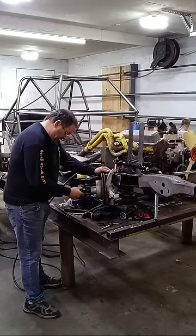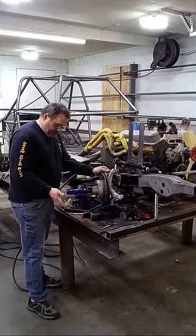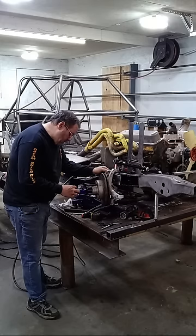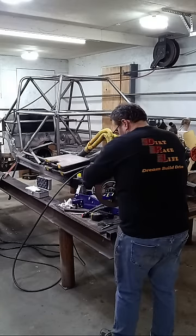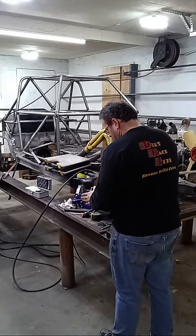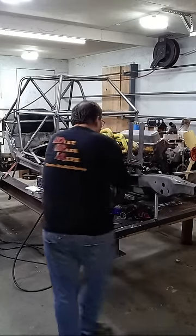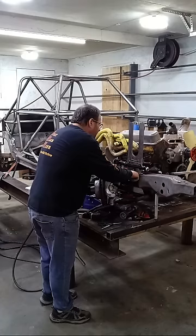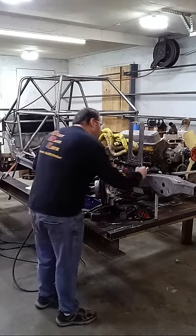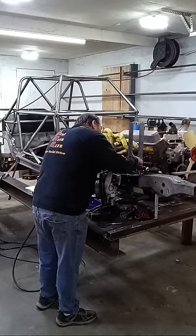We are really just going to take a wild guess on this. I've got an angle here that'll kind of show me about where 20's at. It's about right there. So, set it to zero. 20 out. And then turn around. Turn it back. There. Oh, that's too much. Yeah, that's like 10 degrees. So that's 10 degrees where it's at. I got a mark right here, and I'm going to mark that's 10 degrees caster. Okay.